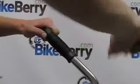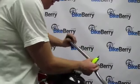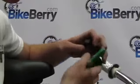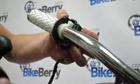Before installing the throttle handles, you must first remove your pre-existing grip handles. Once you've done so, dry fit the throttle grip and kill switch on the right side of the handlebar. Then, mark where you need to drill a 1/4 inch hole into the handlebar.